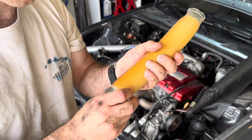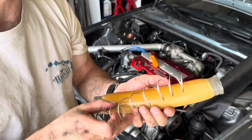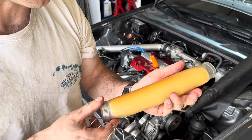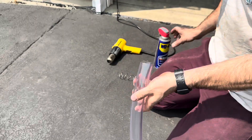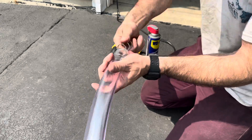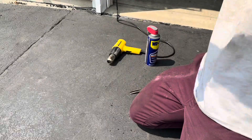I've also taken a piece of stainless steel TIG wire and put it inside the tubing — that's going to hold the pipe from collapsing on itself under demand from the coolant system. Here I'm using the heat gun to make this rigid tubing more malleable and more cylindrical so I can get the spring in. If you've ever made your own silicone radiator hoses, this is how you do it — you can make them into whatever shape you want. I also shot some WD-40 in there to help get the spring in.